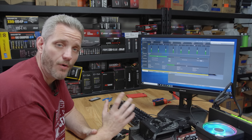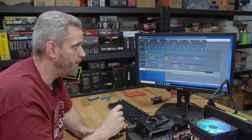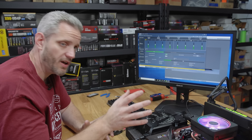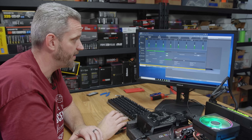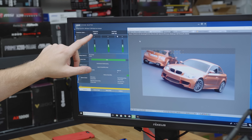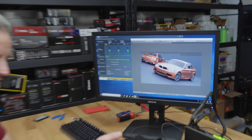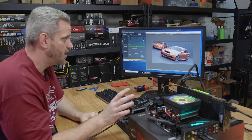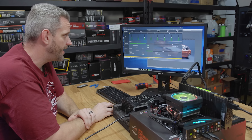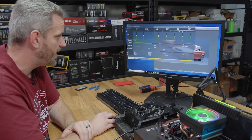The water cooler, when we did our last overclocking video, actually went to 4.075. So we're about 100 megahertz slower than we were getting with an air or water cooler. Something worth keeping in mind. The test is getting ready to finish — we're at 89%, but our temperature has locked at 68°C. Based on the acoustics of the fan, it still doesn't sound like it's at 100%, but it has totally kept the chip at 68°C — 3,950 megahertz across the board at 1.3375 volts.